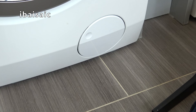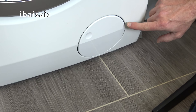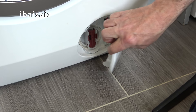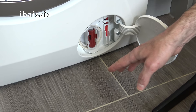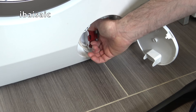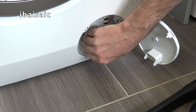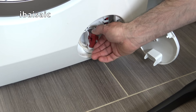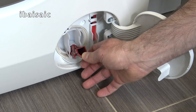Here's another use for Henry Wet and Dry. Most washing machines have a pump filter located behind a round or square door at the bottom of the machine, and you really should check these filters from time to time to make sure they're not clogged up with bits of fluff. But often when you open the filter, water pours out. With a wet and dry vacuum such as Henry Wet and Dry, I can use it to suck up the water that's going to come out. This is also useful if you've had a power cut and the door won't open — you need to empty the water out first. I believe as soon as I lower this spout, water will start pouring out, so I'm going to be ready.